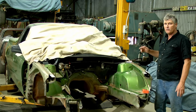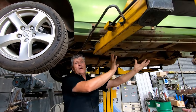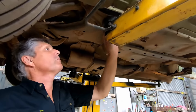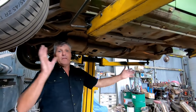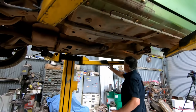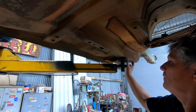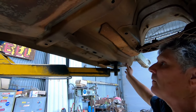We'll lift it up and have a look at what we've done. These rear legs, I've got them swung as far forward as they possibly can go, using my normal lift point which is where the rear suspension anchors into the car. With the car this far forward, I've got the front leg angled out and extended a long way, coming up to just about where I would normally lift. I've got enough weight on the front of the car that it's not going anywhere.